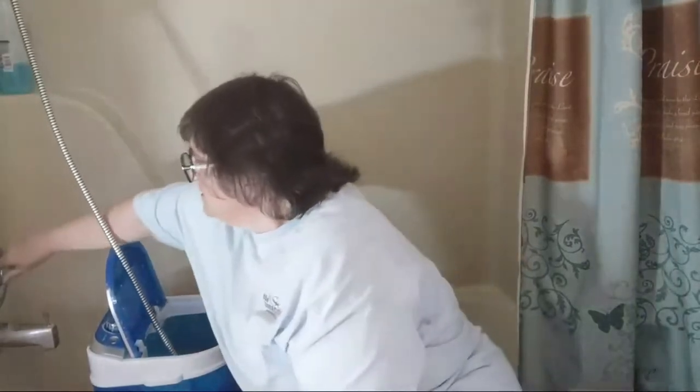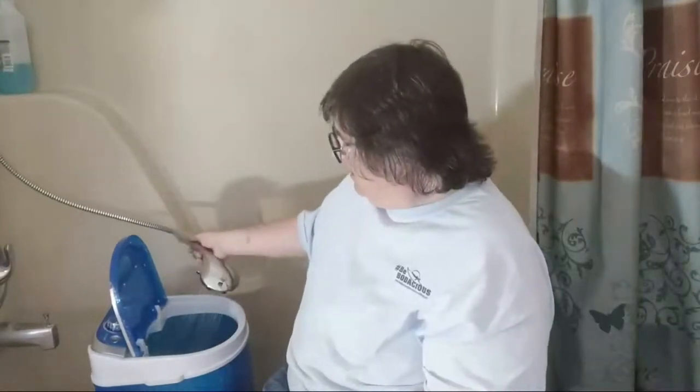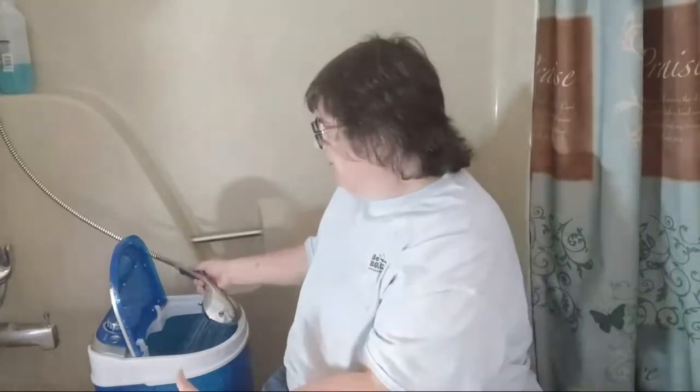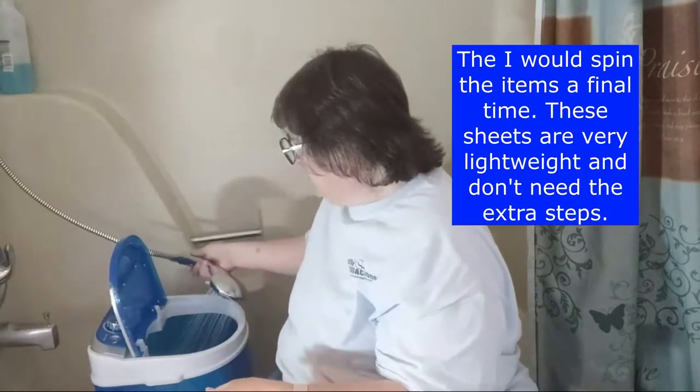This is the rinse cycle. I'm going to fill it up with water. I've put a lot of water in here just rinsing — it goes straight through. But none of these machines are going to spin the clothes completely dry; that is just the nature of the beast. There's no heat going into the dryer portion of this — it's a spinner. It spins around and centrifugal force pulls the water out of the clothes, same as a salad spinner. So even after it spins the clothes, you're still going to want to hang them up somewhere. I can use the wash cycle to add the rinse water, but I'm just adding the water on top of the spinner.